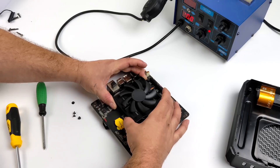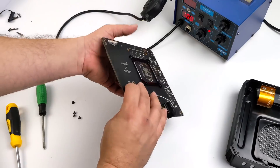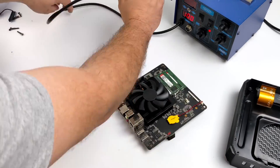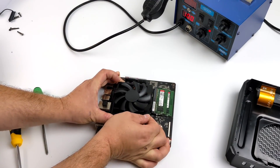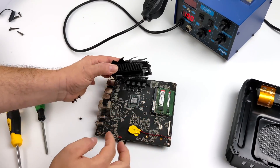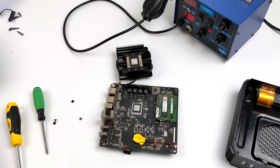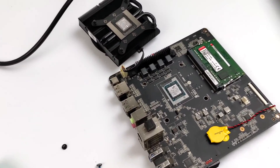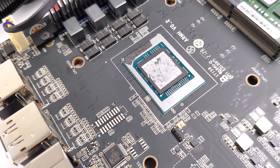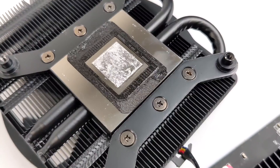I'm probably going to have to put some more heat on it — it doesn't want to go anywhere. When heating from the bottom, the cooler is just sucking up all that heat, so I'm going to heat both the bottom and the heat sink itself to get it up to temperature. With a little more pressure — there we go. We definitely have liquid metal. Not bad at all. They've actually set it up with a couple layers of protection so nothing ever leaks out. It does look like it's applied properly — it's making contact with that CPU and the cooler, and we have a nice even spread.